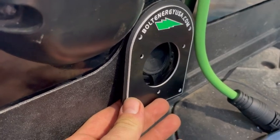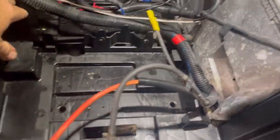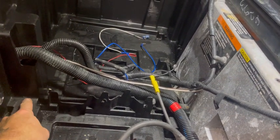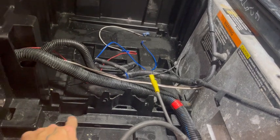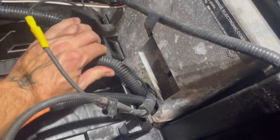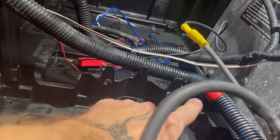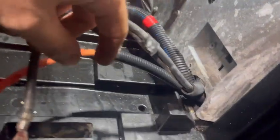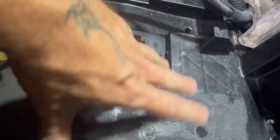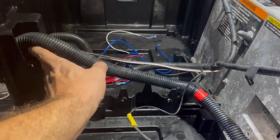In order for the 160 to fit in this limited space, we find it easier to remove some of the plastic holding up this harness. We'll be cutting that down pretty low, probably cutting out a little bit here as well so the harness can run in this channel. We'll also cut out a little bit of plastic there so it's not having to go over the plastic lip. We'll also be shaving down this plastic area. With the mounting plates that come with the battery, we want to match up with this level of plastic — that's about how tall the mounting plates are. Just make sure your wires are out of the way and you're not going to nick any of them.